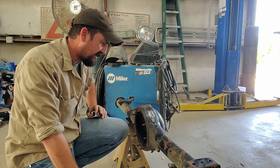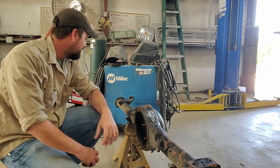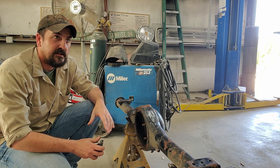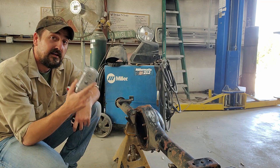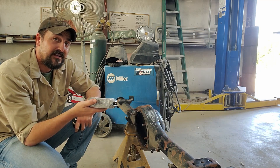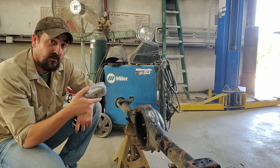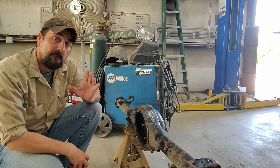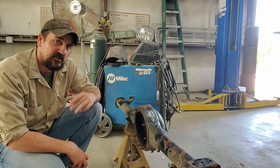Think of all the time I would save doing this — rolling spring perch mounts is a lot of work, a lot of grinding, and it's so hot out here. Could be inside watching YouTube and procrastinating on other things I need to do on the dart, but I'm not going to do that. I got a new set of spring perches, so I'm going to cut these off and then weld these back on, hopefully a half an inch more in than these. Seems like a lot of work for a half an inch, but knowing my luck, if I hog these out I'll find other problems.